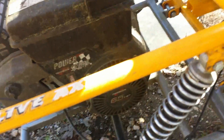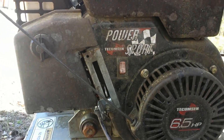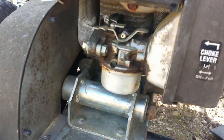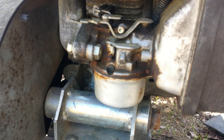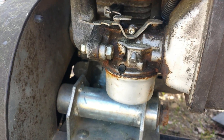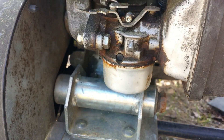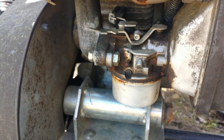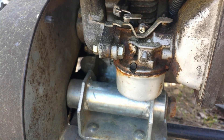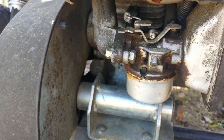Of course I don't like these motors, but this is the best-running Tecumseh I've ever had anything to do with. The worst problem is keeping that carburetor clean — the jets like to gum up after you ride it a while, and it'll start surging when idling or bog down going up a hill when it starts starving for fuel. I just pull that bowl down, blow through it with compressed air, put it back together, and clean the bowl if it's dirty. That's fine — just run the heck out of it.